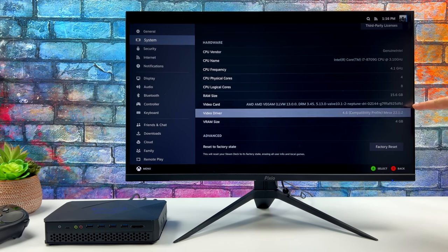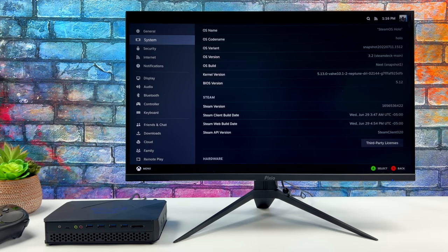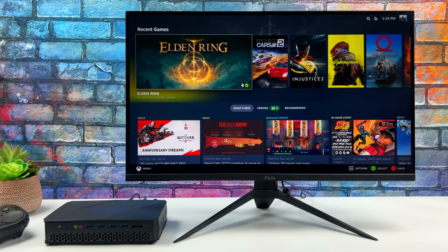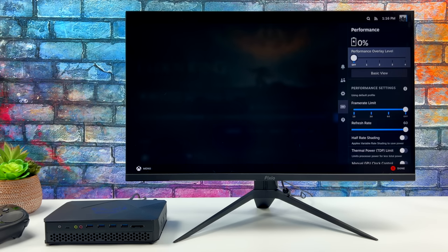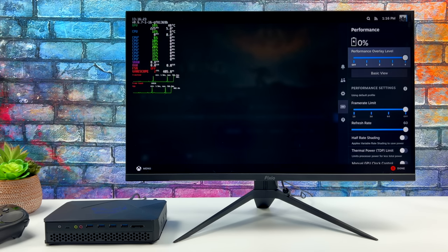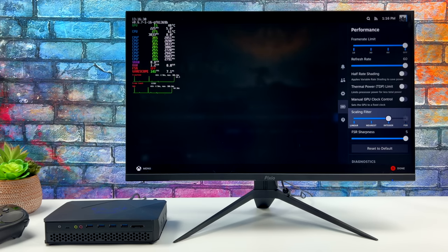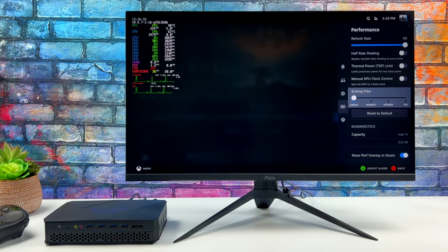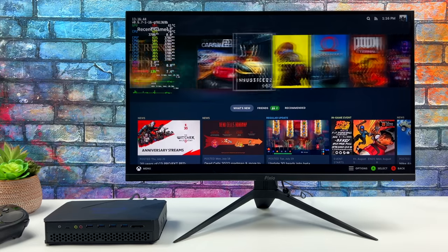I do have system-wide FSR enabled. With these chips we can't change the TDP or clock speed from the Steam Deck menu, but we are set at the maximum that we can go with the CPU and GPU, which is exactly what we want — we're not looking to save battery life since we're plugged into the wall. We can bring the performance overlay menu up, though unfortunately it's not showing me the wattage on the CPU. From the BIOS on this little PC we can actually set the TDP — it's set at 45 watts right now with a boost up to 65.